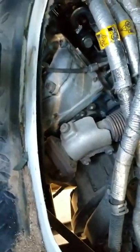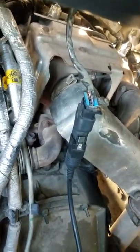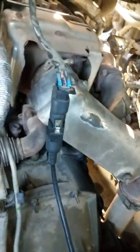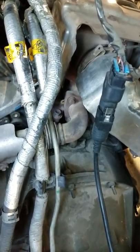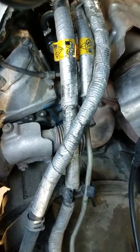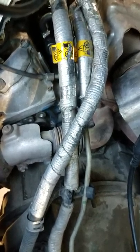What I do is use a Tech 2 scan tool. I take the line off and go for the balance rates first — they don't always tell you that's it. I know other guys say don't use balance rates, it doesn't work, but I'm here to show you today how I did it. This truck came in with a 6,000 pound loss — it's only gaining 20,000 pounds at max fuel pump pressure, and it should be 26,000. I watch how fast the actual and desired values go; if it's really slow, it's usually a low pressure problem.